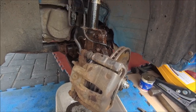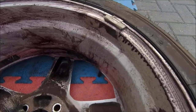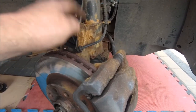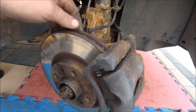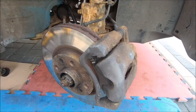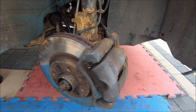Right, let's get the other side done and then we'll give it a test. Time to get slightly anal — clean it up and on to the other side. Yeah it's got a lot of surface rust because it's been standing, but all in all it's fairly new in here — just flaky rust I need to get off, that's about all. Nothing wrong with the disc at all, it's hardly got a lip on it. That'll bed in quite nicely. Right, let's get on with it.